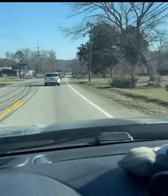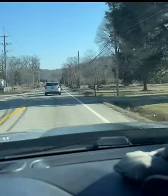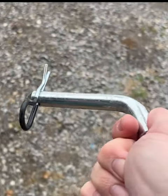Even whenever I towed a lighter camper with a heavier truck — a dually truck — you'd always get a little bit of wear, because that pin that goes in the receiver is the only point of contact holding your receiver and hitch all together. The load's spread out through the shank bar, but actually holding it into the truck, it's just your pin.